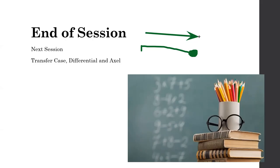So in the automatic gearbox, assume that for third gear, the maximum output shaft speed is 3000 RPM. That's the maximum speed. Assume that for some reason, RPM goes beyond that for third gear. Then the governor steps in and cuts down the speed. It does this by closing the hydraulic pressure going to the gears and changing the gears back to normal. So it shuts down the third gear, then the gearbox automatically goes to the second gear, and the vehicle speed will automatically slow down.